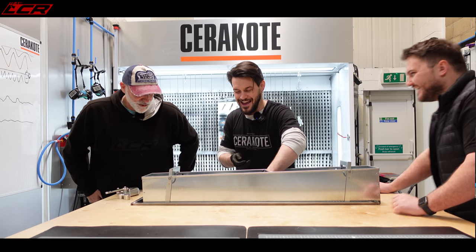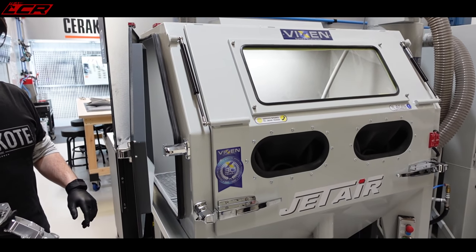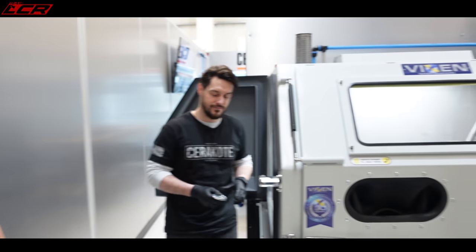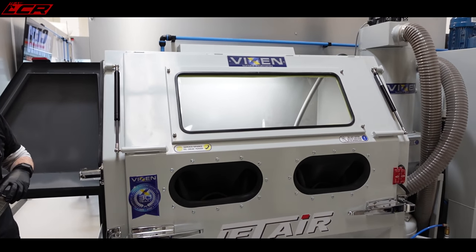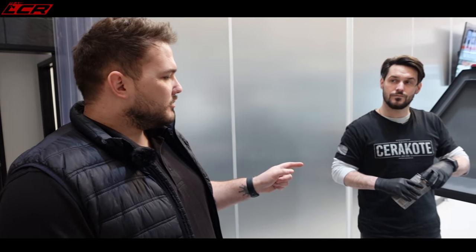It's now the next day — we've had the full 24-hour soak. We're in the same clothes. This is the blasting cabinet. We've got the wonderful Vixen VM55. There are lots of different variations of blast cabinets, but this Vixen is just unreal — it runs on a pressure pot system with a separate cyclone and dust cabinet, so it works extremely efficiently. It gives trainees a chance to use something of a higher end to see what you can do. Nemo is going to pop the small bits into the shake-and-blast canister — nuts and bolts, super easy.